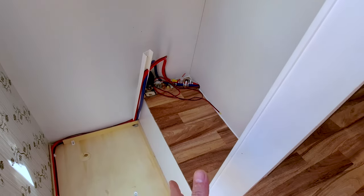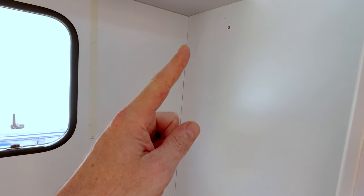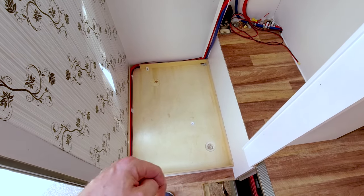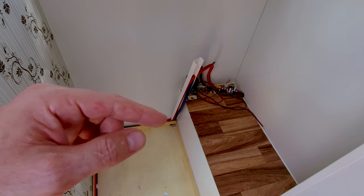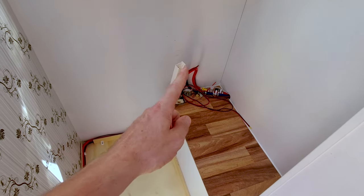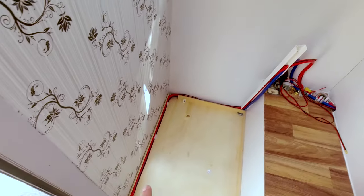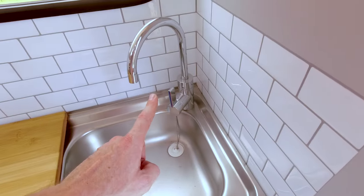In this video, we are going to make some kind of a sink assembly with some storage, put up a little cabinet over here. I have to glue in the shower pan and deal with the gray water tank. In a previous video, we finished all the water lines, fresh water tank and water heater up to that point over there. And I just ran all the lines for that sink tap assembly and also here to the kitchen. So all the water lines go right here and go to the sink and tap.